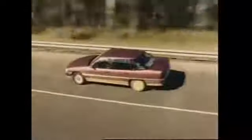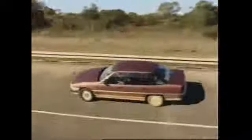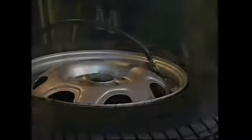The rim must be accurately shaped and dimensioned and strong enough to support the tire under the load of the vehicle and the forces generated by its motion. Passenger cars normally use rims of well-based or drop center design. The drop center is used for mounting and demounting the tire onto the rim. When inflated, the tire is locked to the rim by tapering the bead seat towards the flange or by safety ridges or humps close to the flange.